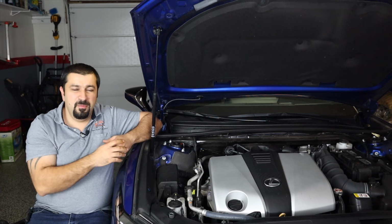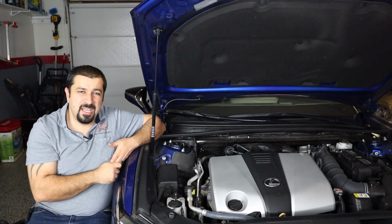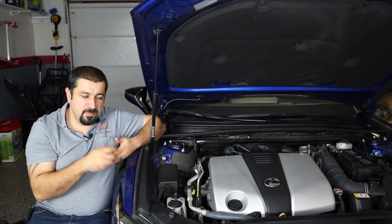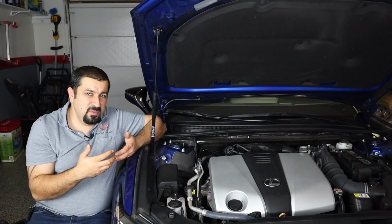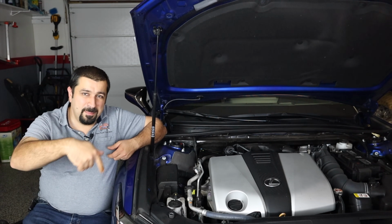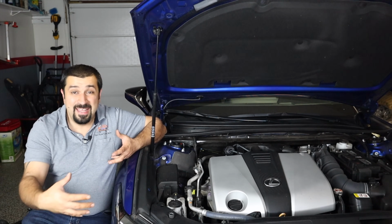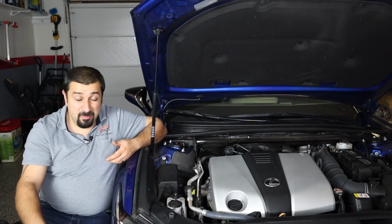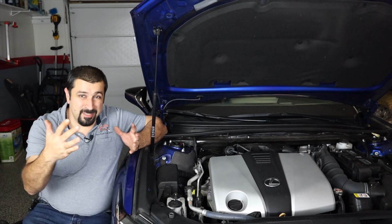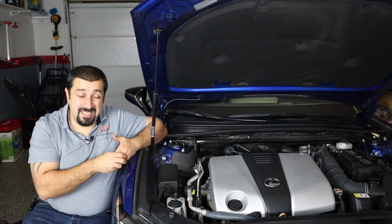And when you pull your cabin filter out, you gotta be very careful. If you see one leaf on top of that cabin filter, kind of stuck in the pleats, there is more inside. This is gonna be a little bit more difficult, but this is going to the next level. Go in with a vacuum on top of the blower motor, or better yet, if you're handy, pull the blower motor out when you've had leaves on top of the cabin filter. Clean it up, and now you have no chance of adding to the clogging of the AC drain, because this is so simple and yet it can destroy the car.